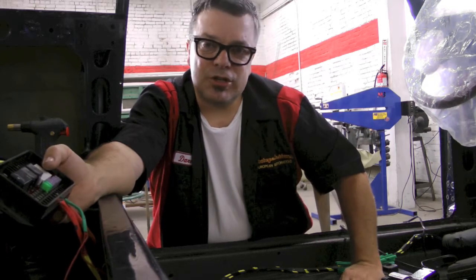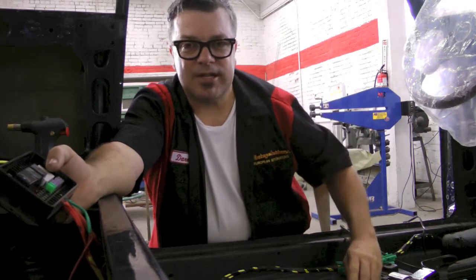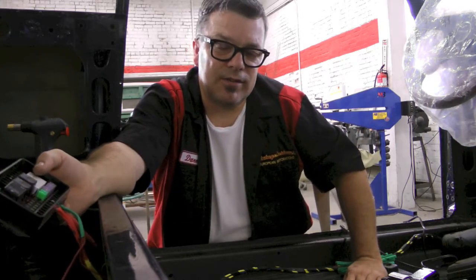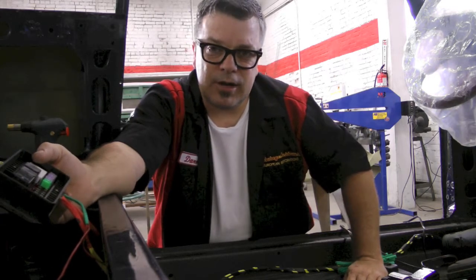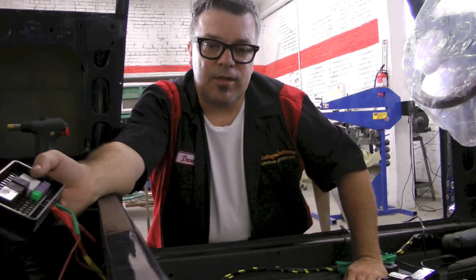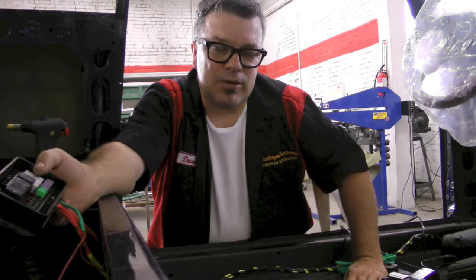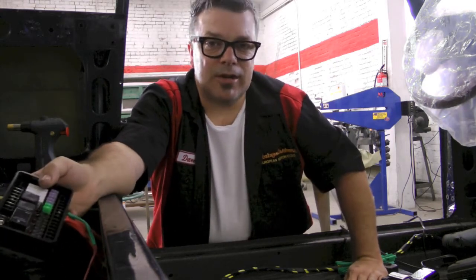We're running our own wiring because this is a very complex car — with its air conditioning, electronic controls, and the really trick racing dash we made, there's a ton of electrical that was not part of the original car. If you're not sure what the electrical conditioning of the wiring is right now, this isn't such a bad idea. Insulation degradation is a fancy term for wiring that starts to break down. Any car of 30, 40, or 50 years will have some degree of it. Connectors get weak, the wires get hot, they start to cook — that's insulation degradation.